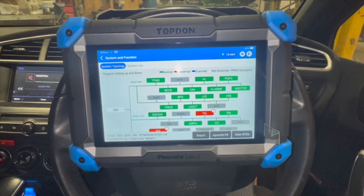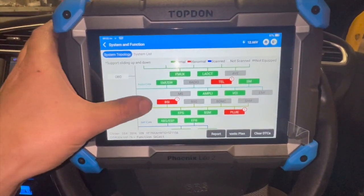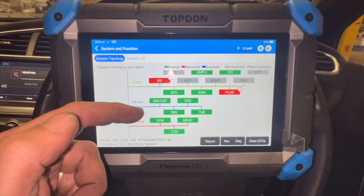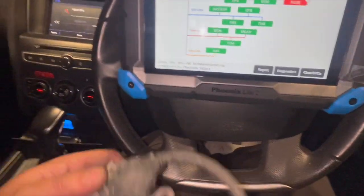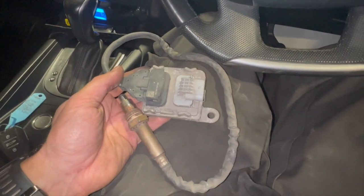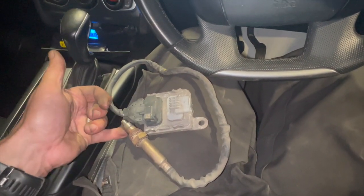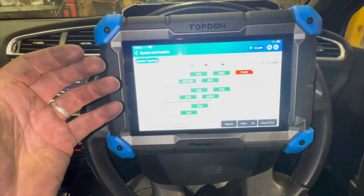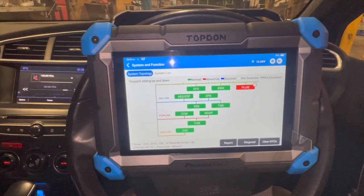I've just got back from a really decent road test — done about 15 miles and no faults have come up. It's run absolutely perfect. On a full scan, nothing's come back in the main engine ECU. We have got some other issues in there which are completely separate, but the main knock sensor fault that was coming back every time is gone — it's green, no faults at all. So I'm quite happy that it's definitely fixed after that road test. These are quite an expensive unit for what they are, but unfortunately they are becoming quite a common issue. I have known these be fitted in the past without being coded by the ECU and it has always cleared the codes, but if you have a machine to do it and the option's there, it's always advisable to run through it. Hope you liked the video — give it a thumbs up, subscribe to the channel, thanks for watching.